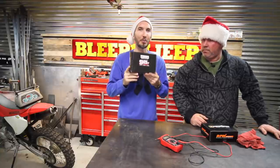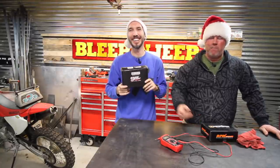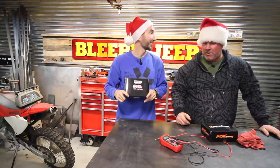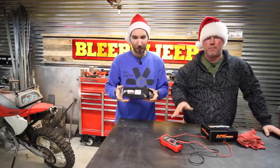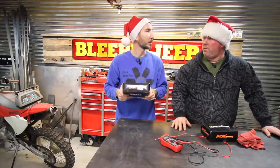Where do you think you could use these? Four-wheeler, dirt bike, jet ski, lawn mower, boat. How about a Jeep? A car, a truck, a semi-truck, your tractor. The thing has a 500-amp rating, so your winch doesn't pull more than 400 amps — this is peak amps. A diesel pulls quite a few amps, so I'm not sure it should go on a diesel. But boat is a good one. If we can find where these are manufactured, I will get some for the website and be a dealer.